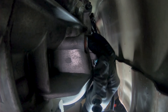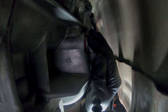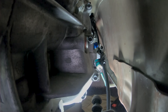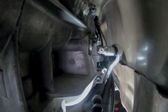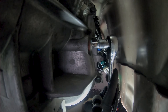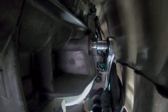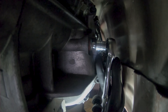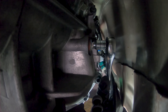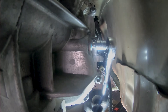You can find the fill hole on the very back of the transmission where it starts to meet the drive shaft, about halfway up on the passenger side. I put in a little extender on mine. If you don't have one, you should be able to make it work — you just have to put the handle of your ratchet effectively towards the rear of the vehicle. I'm just going to snap this in place and make sure I can open this up. Awesome — nice and easy.